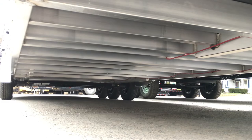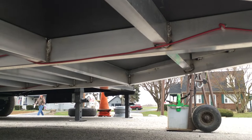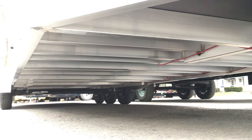It ties in so many more places. If you look back, you can see all the cross members of the 4-inch tube and notice the triple tube tongue — how it comes back and how they integrate the frame. There's a lot of work there, but these guys have a lot of automated equipment that makes this possible. It's a very impressive tongue and mainframe — certainly the most impressive I've crawled under. Not only are the cross members impressive, but how the tongue and mainframe all integrate makes it a very, very strong setup.